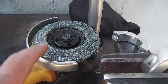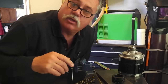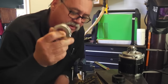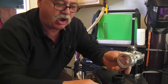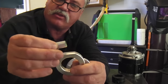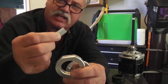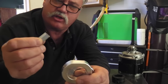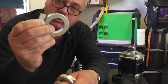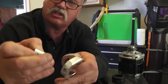On your grinding wheel and your flap disc, the aluminum loads up on those, but no big deal. Christian Livingstone here — I've got those aluminum collars and I'm getting ready to weld them up. But before I do that, I just want to show you how I prepped them. You can see I've left about a one-inch flat spot for these little barrels to go on top of. These came right off the existing mount from the Cyclone motor, but we're not using it. We're just going to use this piece along with these collars — weld them together and this will do it. They're flat on top, with a little bevel on each side. I've kind of beveled this a little bit too.